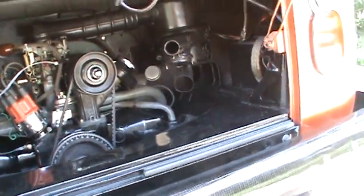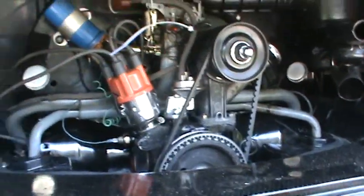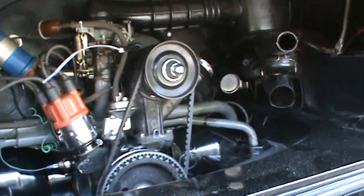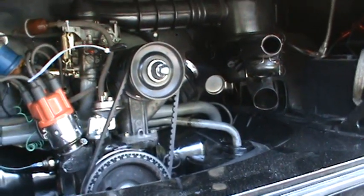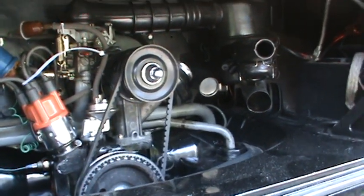But we got the head issue, and I'm gonna have to deal with that. You can see the push rod tubes are fairly dry. It's not like the heads are falling off of it, just enough to make the noise. I'll probably drive it a little bit. I'm not gonna take it out today, and you know, you get a million things going through your mind. I was gonna pull it out and build this motor and put these heads on this, and I just need to stop and regroup and put the motor in here that I really want.